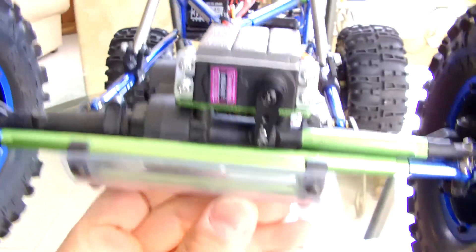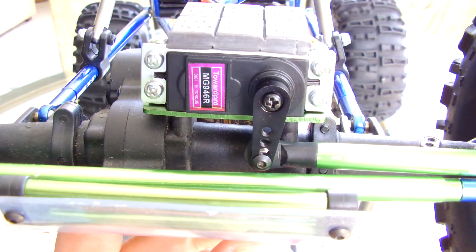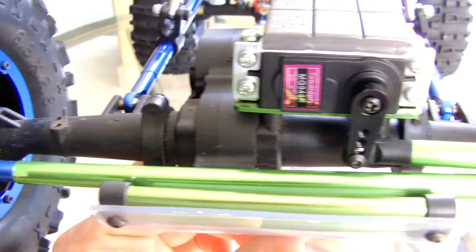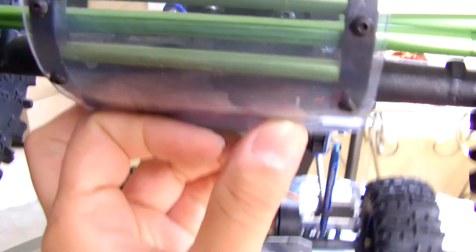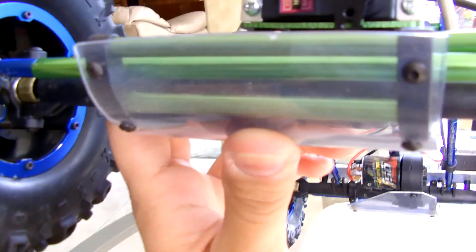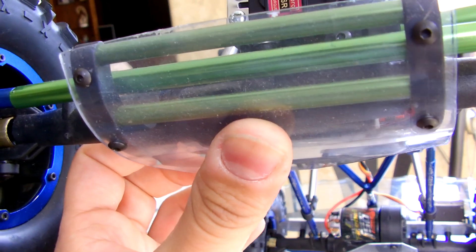This is the rear steer. I didn't have to change the wiring on the servo motor itself because I have the GT3B and modded it to do four-wheel steering, so I get to reverse that servo and run that bar on the bottom. I'll show you the four-wheel steering later. This piece of plastic is also used as a skid plate on the bottom. The factory has those rods, but as everybody who has one of these knows, those rods don't really do much except get you caught on rocks and wood — you just get caught everywhere.